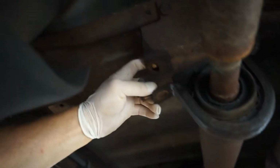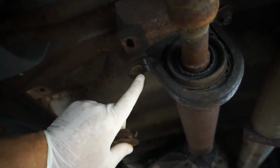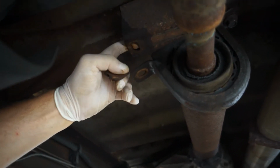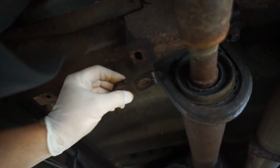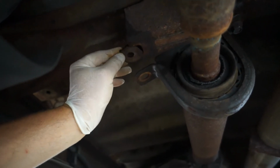And you can always just put a bolt up top of here, I mean a nut up top of here and a washer. So you'd use the bolt and the washer, and then another nut and a washer up top of here. You could use a split ring lock washer if you want to make sure it doesn't slide, but you can see how that thing goes through like that. It sits up on the frame. And they're just like a quick nut, speed nut type deal for a fender.